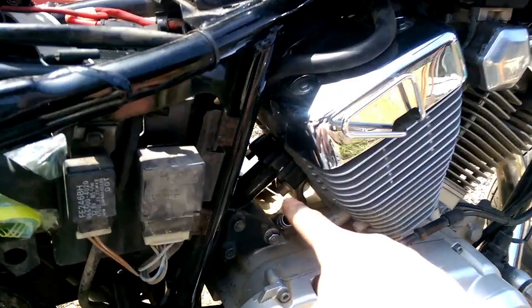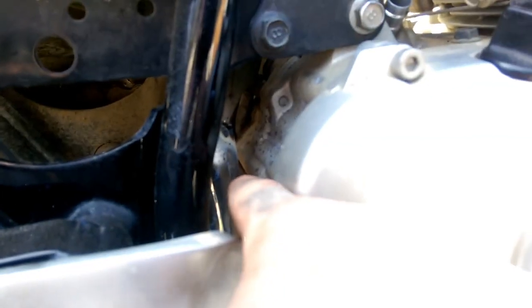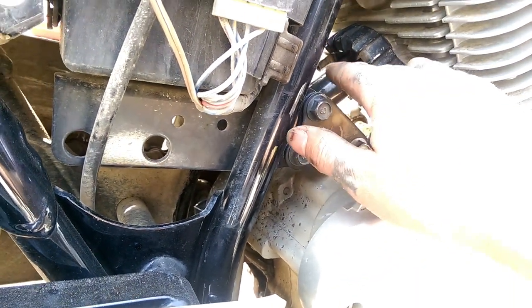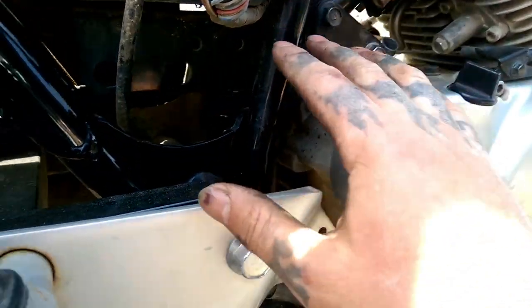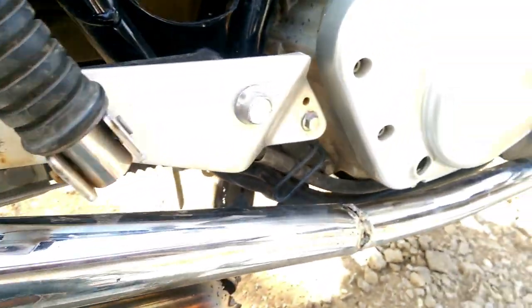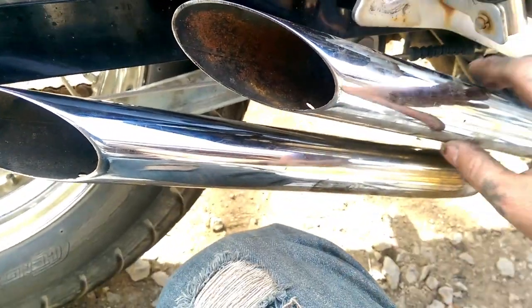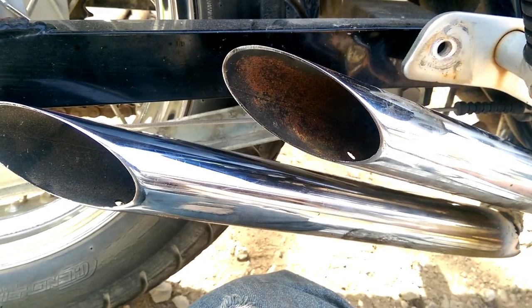I did keep this pipe — I had to do a little fitment on it, but I took it down this way and then started right here. This kept some of the back pressure by keeping this longer stock pipe section. We'll wrap it in header wrap and I don't think anybody will ever notice. The pipe actually runs down inside this factory tube — I just got it tacked on — it runs all the way down to here, so I should keep all the back pressure, and then they come out right here open exhaust, somewhat like from the factory. Now I've got them all fitted and tacked on — I'm going to mark them, clean them up, and weld one at a time.